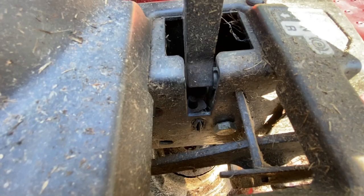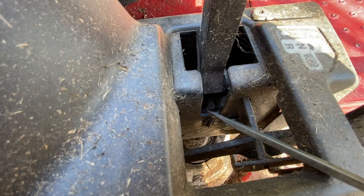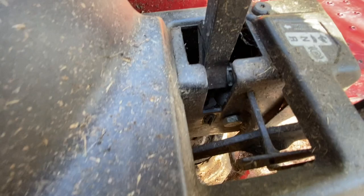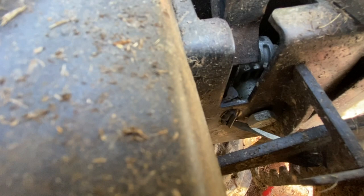I'm going to point to it with my screwdriver — right there, that's your safety switch. I'm touching it, and what it does is it gets pushed down when the handle moves in. It looks like it's only held on by a clip here — it's pushed into the side. I'm going to just try to push this switch out. I don't know if this is the right way to get them off, but I don't want to have to take the whole mower apart. Yeah, it's almost like you can just push through right here.